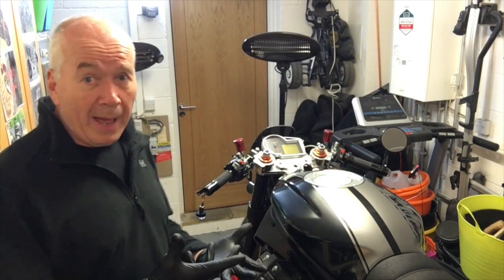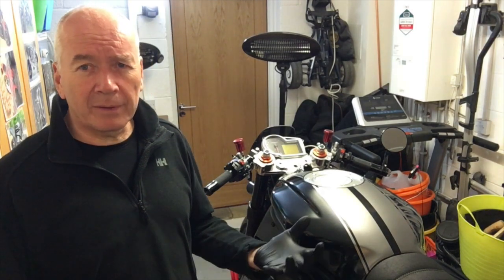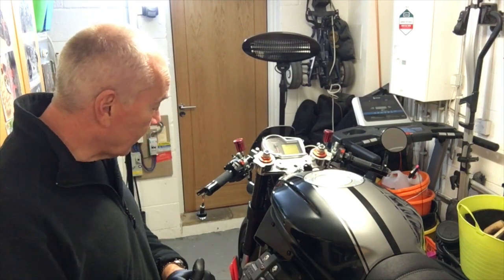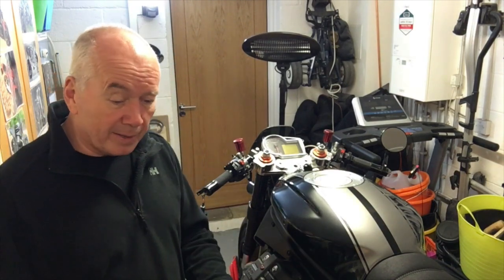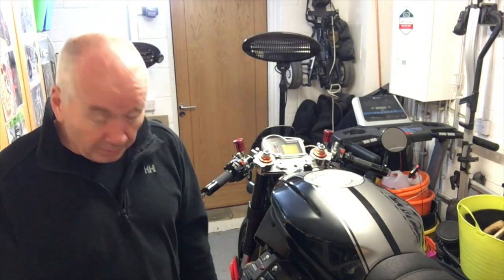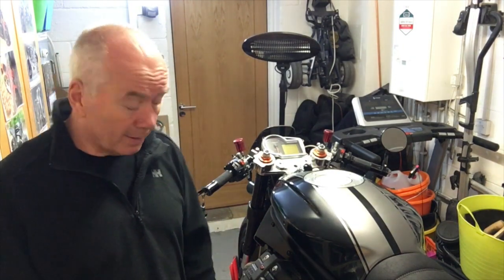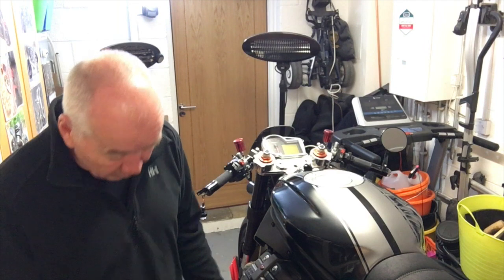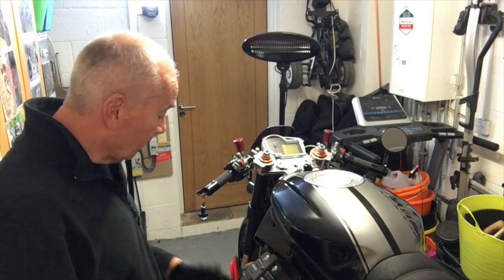Second thing, when I got back, it had that hot smell about it, and it was only about 6-7 degrees. So I'm thinking this can't be overheated. There's just no way. Afterwards, I noted when I parked the bike that there was oil dripping off the front of the crankcases, almost where the side stand is mounted. It seemed to be dripping and running down. There's quite a lot of oil around the engine from the barrels downward, so crankcases mainly. So nothing coming from the top end as such, or so it would seem. So I've got to look at that.